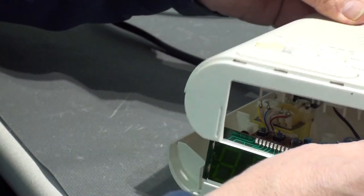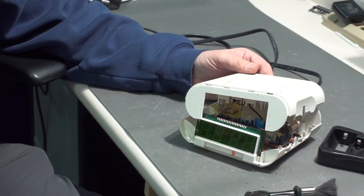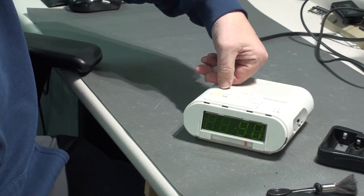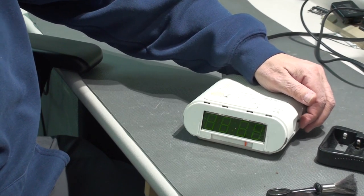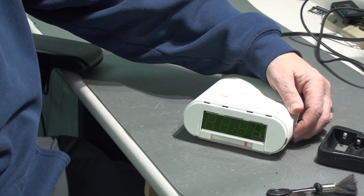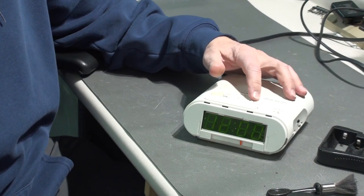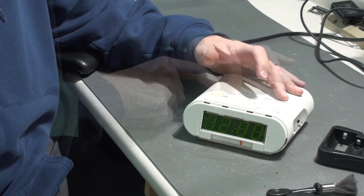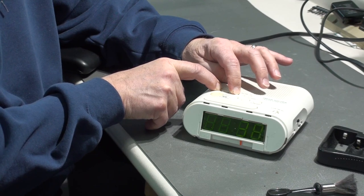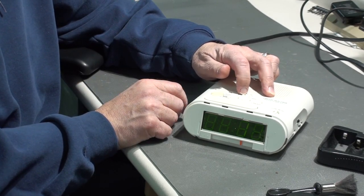A little better. I'm just going to pop the lid back on and see if we can get it to work and see if there's any change after having cleaned those contacts. Okay, so we've got the radio working all of a sudden — it's not tuned, I'll tune it into a station. There's a radio on/off button here — that's working, turn it off. These buttons are pretty iffy — some of the time they're working, sometimes they're not. But after working it for a while it may be enough. You really have to push these buttons to make them make contact, so I think they are dirty inside.